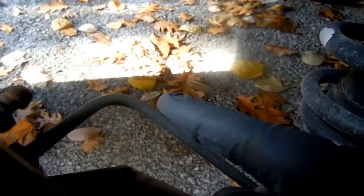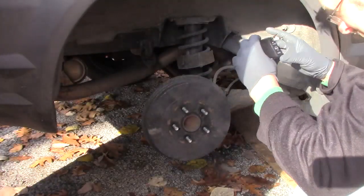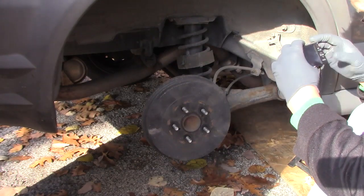This is the brake line as it follows a path to the back of the brake cylinder. Above the brake cylinder is the bleeder screw. The back wheels are drum brakes, the front are disc, but we'll be bleeding them in exactly the same manner.